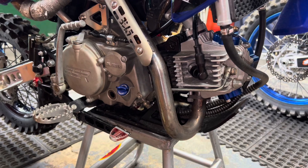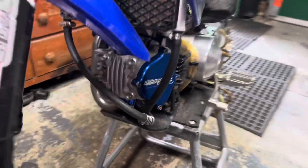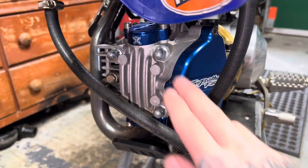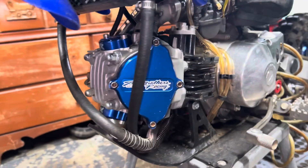I'm going to show you how to install it the correct way. The hardest part is just knowing which way the camshaft goes — the orientation of the cam. Other than that it's pretty straightforward. You're going to want to torque your head studs to 16 foot-pounds. That's what I always do and I've never had a problem.